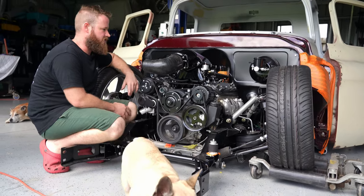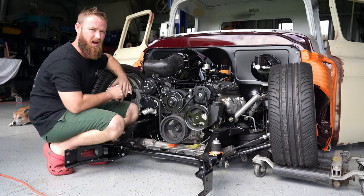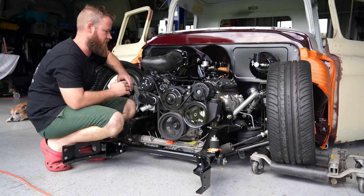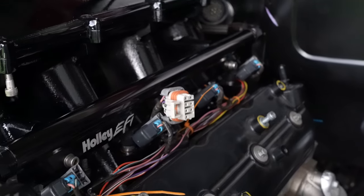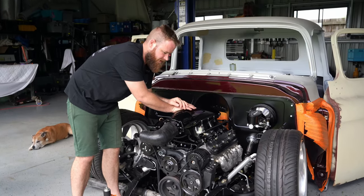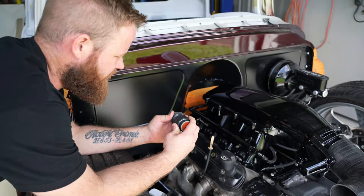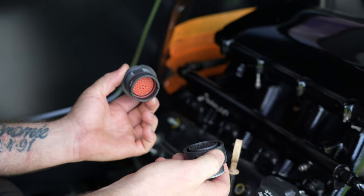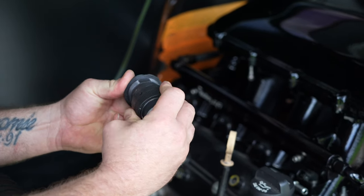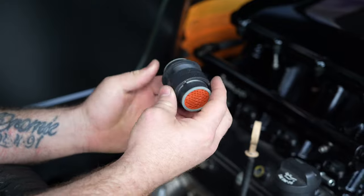In the Commodore that this engine is out of, all the wiring basically runs down the motor to the front section. You've got the ECU and the battery and all of the fused blocks and bits and pieces in the engine bay, and it looks pretty average in my opinion. So I basically cut the harness to pieces and I'm remaking and rewiring the whole thing so that it's as clean as possible — the harness just runs down each side of the motor and behind the motor and goes through the firewall with some bulkhead fittings. That should clean it all up and make the engine bay look really nice. These two run through the firewall — it's just a quick disconnect fitting, simply twist and they separate. This side will be mounted in the body of the vehicle and this side will be on the engine harness, so if I ever need to take the motor out or even the cab off, it's as simple as lining them up and locking them together. Pretty easy and they look pretty trick too.